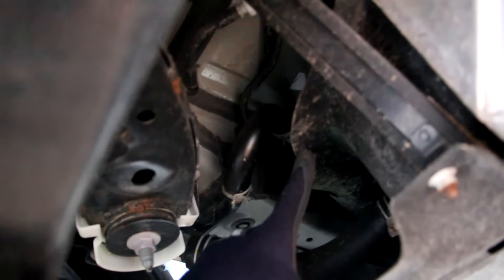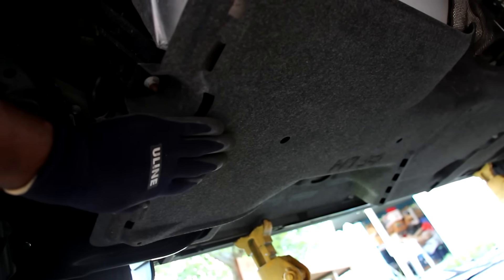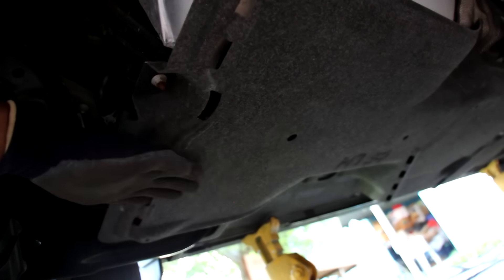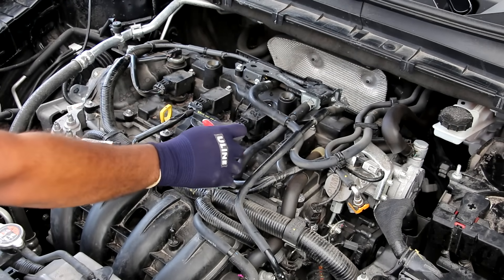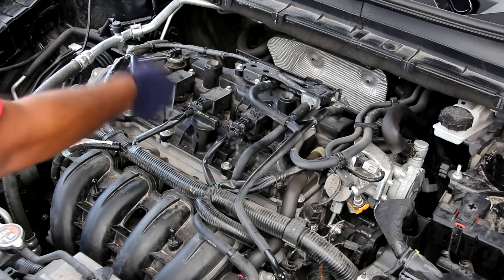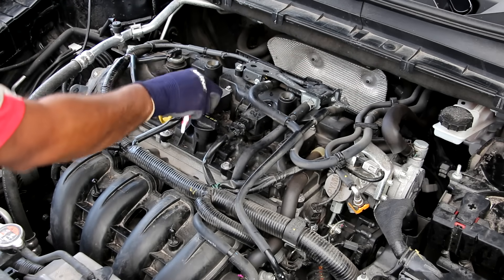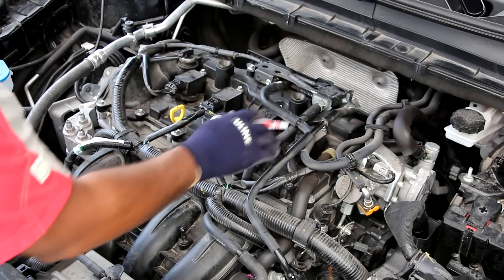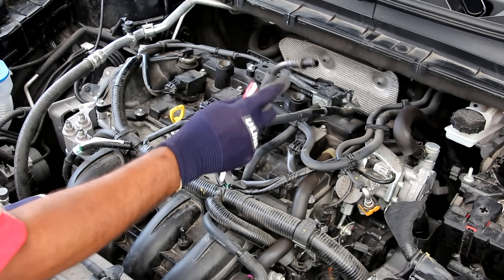Just behind the rear left wheel we've got a peek at the fuel system — you can see this is the gas tank, it's a stamped steel gas tank with two parts. Underneath the left side carpeting just in front of the fuel tank is where the evap canister is located. Taking a look across the top of the engine, we have a plastic valve cover with the oil filler cap — luckily this takes 0W-20 weight oil. We've also got the oil dipstick and four ignition coils that are really easy to access when you need to change your spark plugs. At the back we have the purge valve for the evap system with a line that goes down to the intake, and a ventilating tube from the valve cover to the intake.